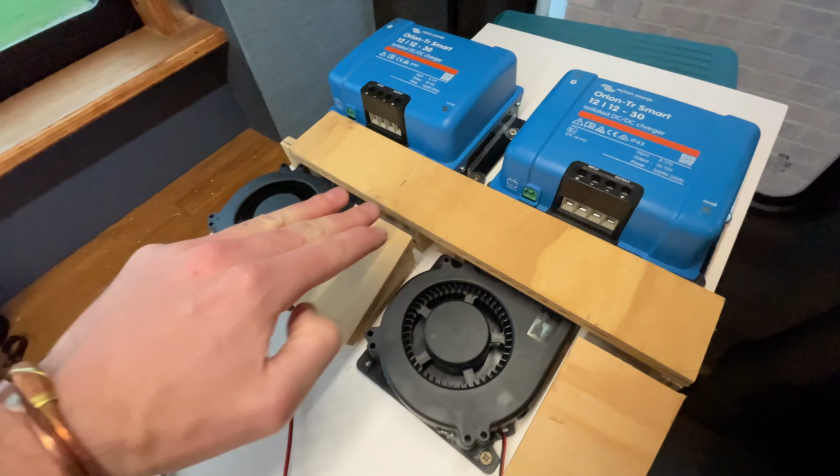Right, it's a few days later, and the components I want are all here. Particularly what I needed were these fuse boxes. On this board, there's gonna be eight different cables. All the positives of these need to be fused, so the positives going into the unit need to be fused and the positives coming out of the unit need to be fused. The other thing I needed to figure out was how to turn the 50mm cable into two 16mm.